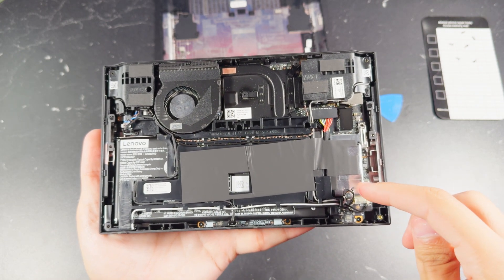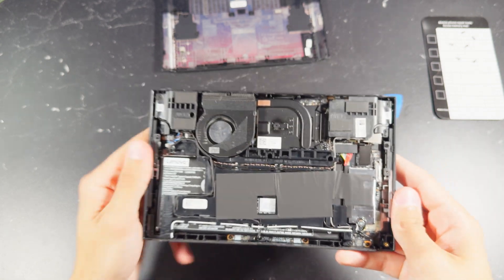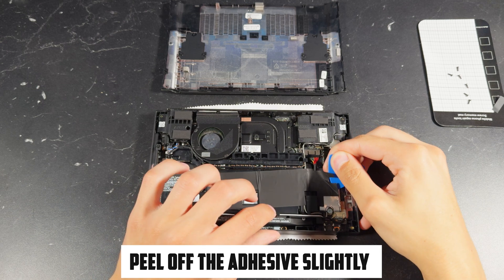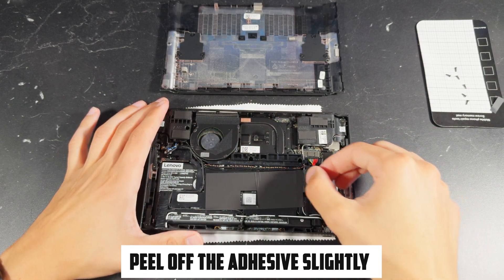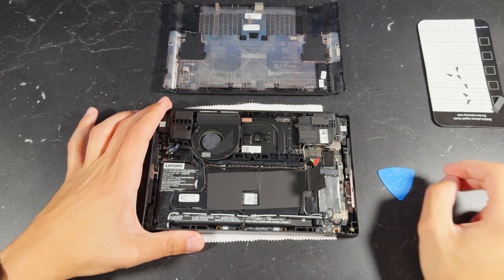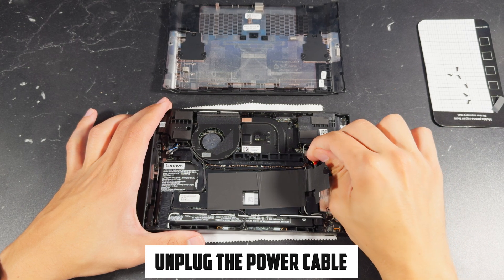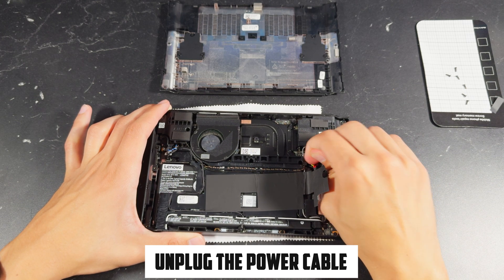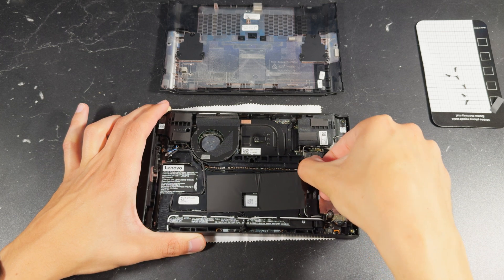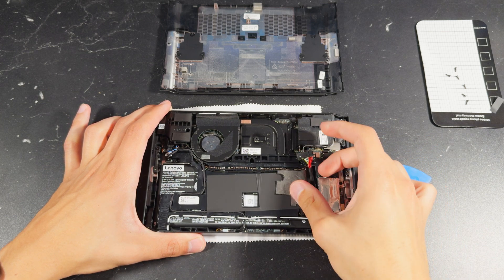Before doing anything, it is very important to disconnect the battery, so let's do that first. Go ahead and peel off that little adhesive on top of the SSD. Then right on top of the power cable, there should be another small piece of adhesive — make sure to remove it as well. Go ahead and unplug the power cable, making sure to go slow and be very careful while prying it out. You might find it easier to do so with your fingers rather than a pry tool. Once you wiggle it free, push it to the side away from the SSD so we can get some space to work.